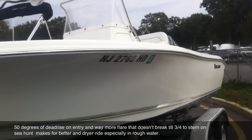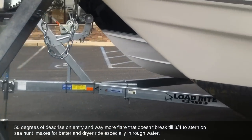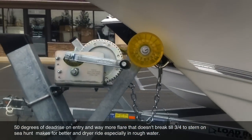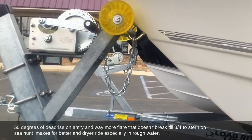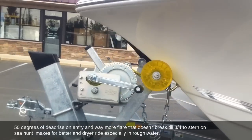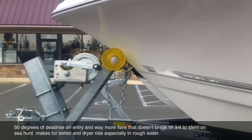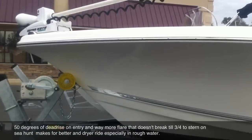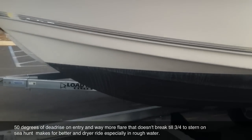Here's your Tidewater. I'm going to show you neck and neck. Here's your dead rise on the Tidewater, which is about 40 degrees of dead rise. Now the Sea Hunt Ultra 196 is behind it, and we are neck and neck here. If you can see between the trailers, it is cutting the water ahead of the Tidewater because it has 50 degrees of dead rise on your entry. The entry is a big deal in rough water because you are cutting the water in the front of the boat. With the Tidewater, you're losing footage — by the time it hits the water when it slopes down, you're not breaking the water until further back, so you've just turned your boat into a 17-foot boat. You lost two feet of effective boat in the water.